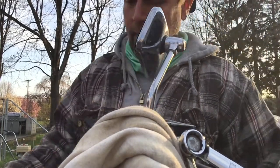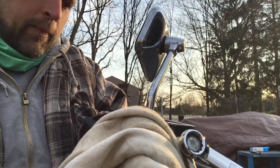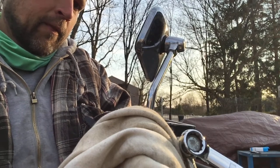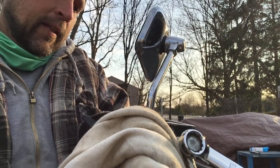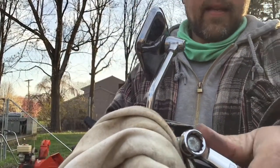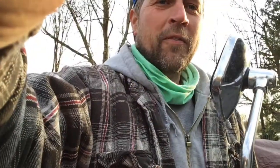All right, gotta pump it up real slow. One, two, three, four, five, six, seven. You gonna hold it in, give your banjo bolt a crack real quick. Now you can let it out. You heard that, didn't you? You heard that spritz? That was air coming out.